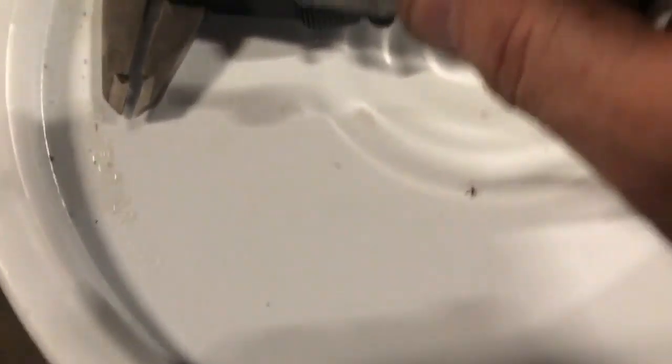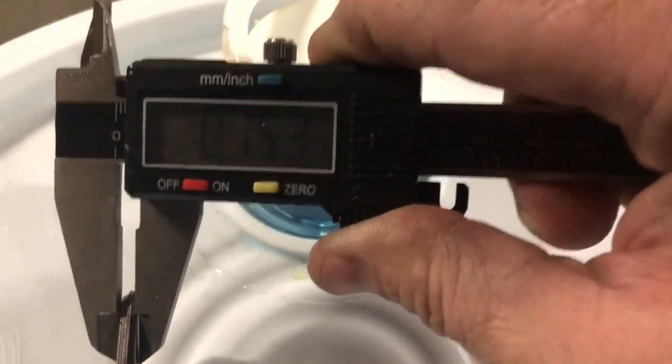So this is the gap we have right now. It's pushed all the way into the transmission, into the front pump, as far as it'll go — and this is the torque converter clearance. We've got our feeler gauges — these are the ones that went in there. I measured it and when you squeeze it in between, I use the slide caliper. I got about 150 thousandths — 152, 153 thousandths. That is about perfect. Most converter companies say somewhere between 125 thousandths and 187 thousandths. On some turbo cars I run a little bit looser than that because it's harder on the trans brake, but somewhere in that range. We're right perfect in the range where it needs to be.